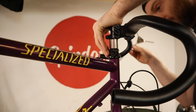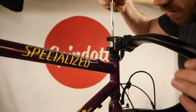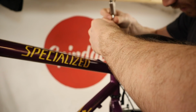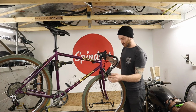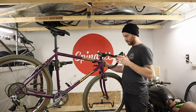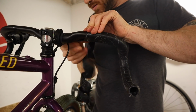It's 10 mils higher at the clamp area, which is beneficial for this bike because it is so long and it's quite low in the front, because it kind of straddles the line between mine and Angela's size bike. So having the bar have a little bit of rise keeps me from having to raise the quill stem adapter, which would just be lame. It's also probably the biggest reason that I decided to go with this bar for the Rock Hopper. The lesser amount of flare and my preference of the curve of the drop are just bonuses, like cherries on top.